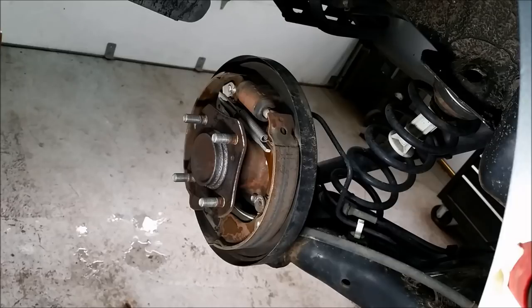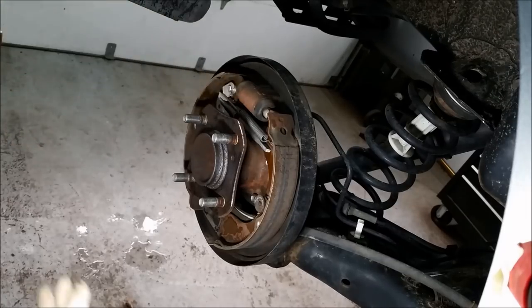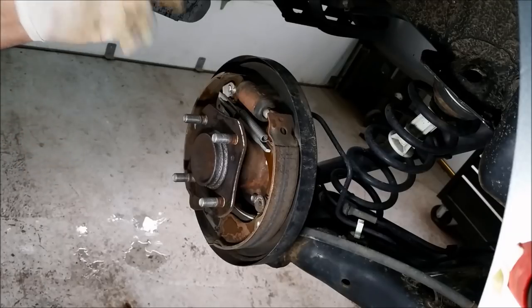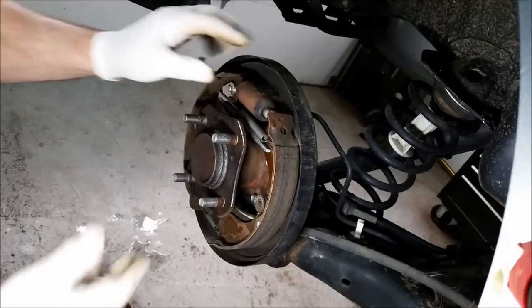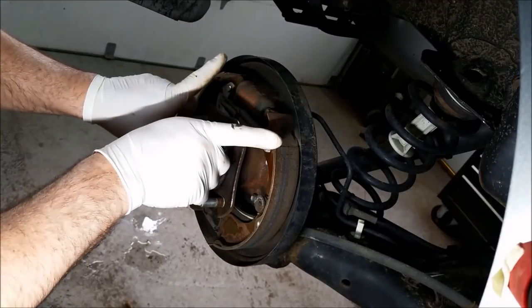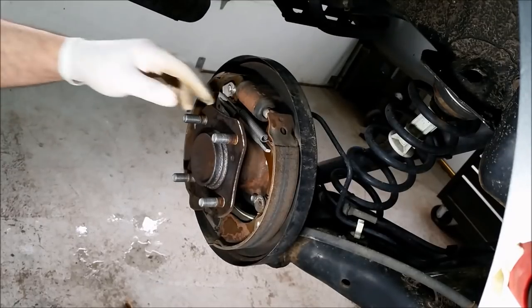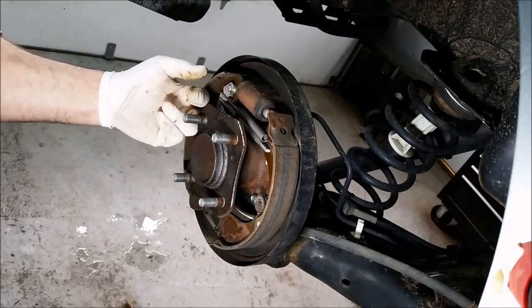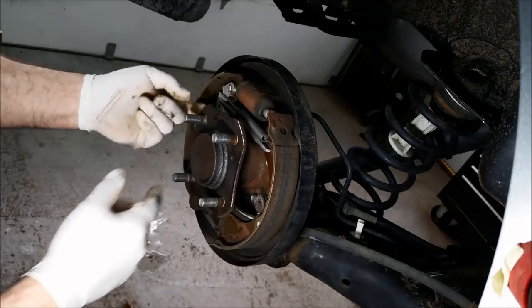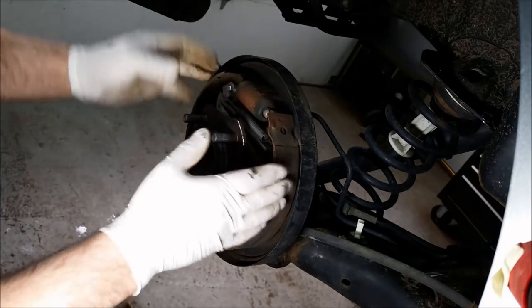I hope this is a good angle for everybody — a little difficult. I want to get close enough where you can see all the components but obviously not get in my own way. Real quick: wheel cylinder, fluid inside, step on the brake, fluid pushes out, pushes the shoes out, contacts the drum, stops the wheel from spinning — basic stuff. Self-adjuster star wheel: as you step on the brakes, if it pushes far enough, it pulls the arm up, turns the wheel, makes a slight adjustment, keeps the shoes close to the drum.